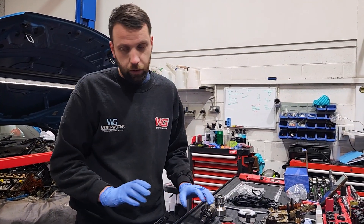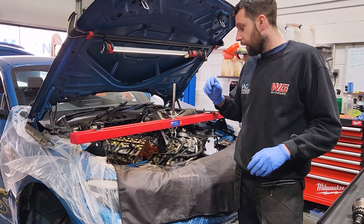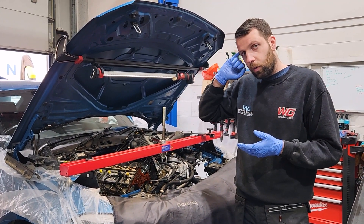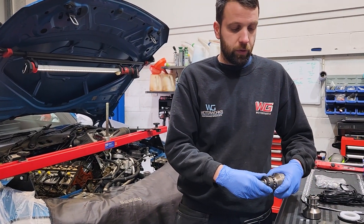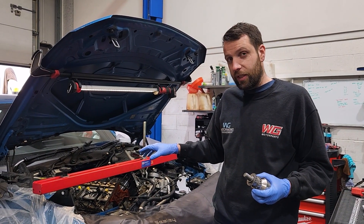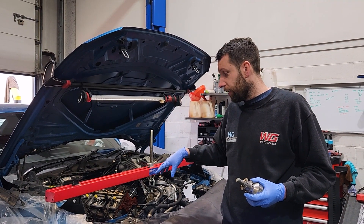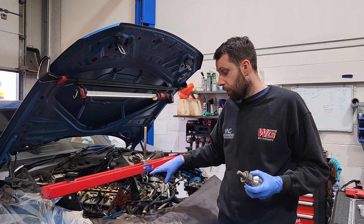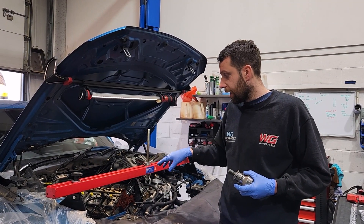The reason it actually slips is the standard turbo response — it's very spiky. It's not the amount of torque, it's how it's delivered. That sudden surge of torque when it comes in — that torque moment — can cause a slip. People say stage one cars don't have issues, but in fact the majority of the ones that have slipped in have actually been stage ones with unknown tunes. This one is stage one with a completely standard exhaust. But typically, stage twos have a lot more issues.